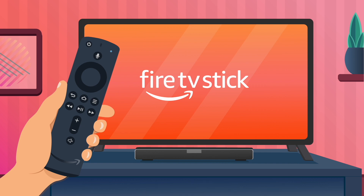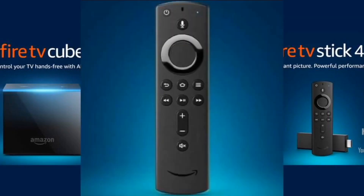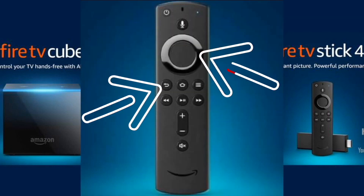We are going to do a factory reset on your Fire Stick. Now this will erase all the stored information that you have on there and make it as if you bought it brand new fresh out of the box, so you will have to download all your apps and set it up again. To perform this reset, press and hold the back button and the right side of the navigation circle together for 10 seconds. A screen will then appear asking if you want to do a factory reset. Select yes and the reset will begin.